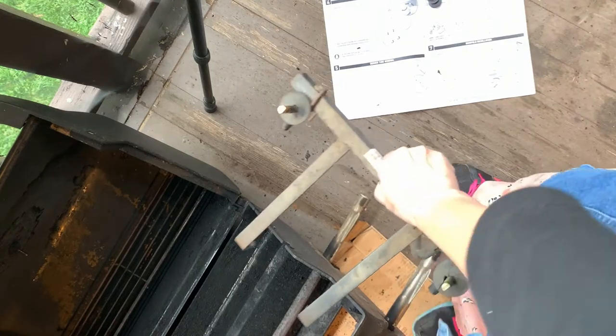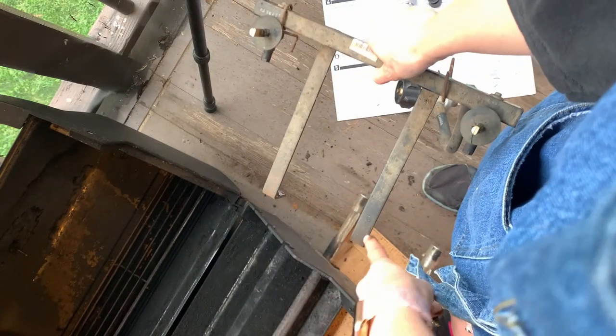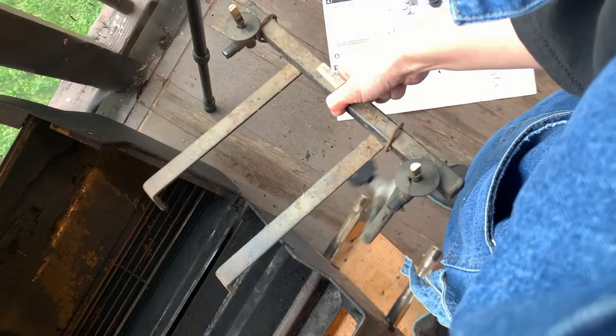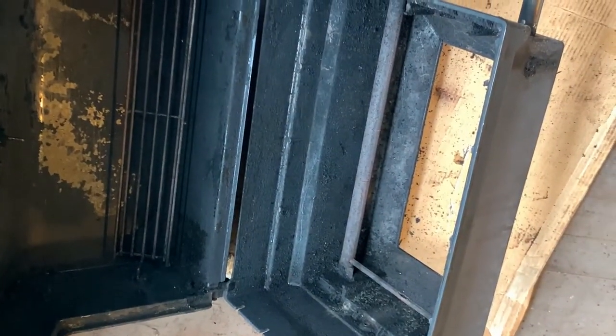So actually, these are the two screws that were inside the grill that attached to the nuts. I was pointing to nuts that I unscrewed, and it wasn't the actual screws. You see, then you just slide it out. Now I will slide the burner tubes out. It's actually quite simple. And make sure that you don't accidentally try to unscrew the guides for the burner tubes.